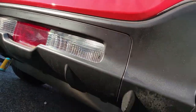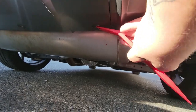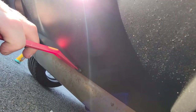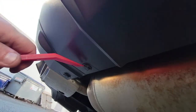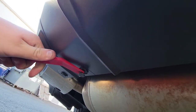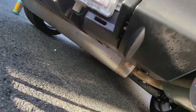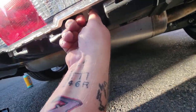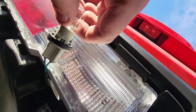For doing the reverse lights, it's a little difficult because they're brand new plastic clips. You get the panel popper in there, break that loose, break that loose, and finally you've got the third one right here — break it loose, grab here, pull. It comes out and then you have access to the bolts. Twist, and it pulls right out.